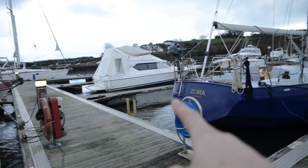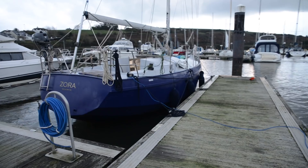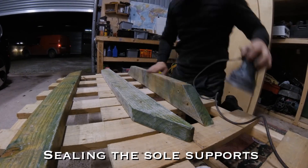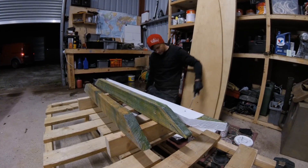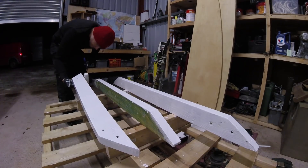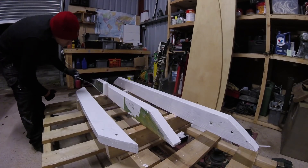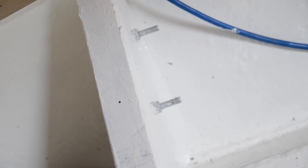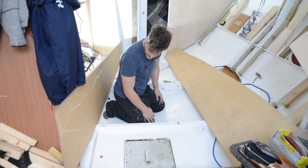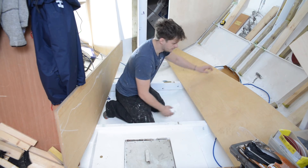I can also tie her off from the other side so that when we get strong easterlies, she won't heel as much. She heels quite a bit at the moment because of the under-ballasted situation, but she's looking pretty good. We've finished painting the floor timbers. They've actually been bolted in now, and you can see all the way along the edges here — they've been sealed with Sikaflex and bolted in. Once these are fully set, they'll never move again. Next job is to put the flooring in.